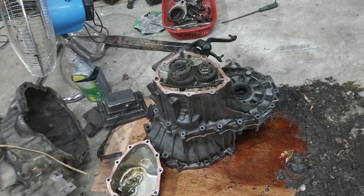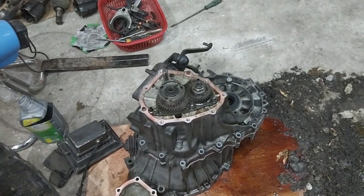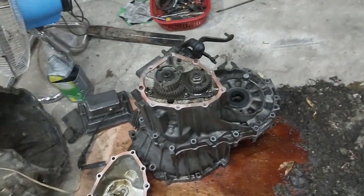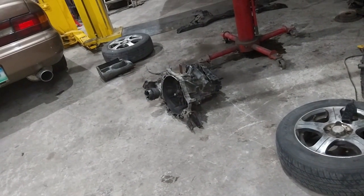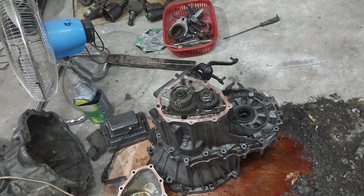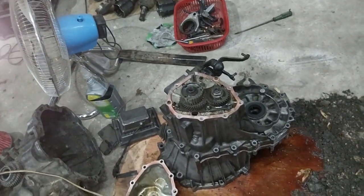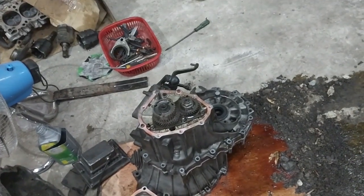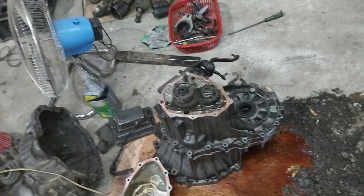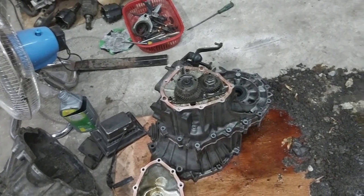In the process of disassembly, I also acquired what is supposedly a C56 transmission. We'll confirm by counting the final drive — if it's a C56, it should have a shorter final drive of around 4.2 to 4.4, compared to the C52's 3.7. This one has an open diff, but I've acquired a clutch-type limited slip differential to put in it, assuming it really is a C56. However, it's known to have a grinding third gear, which is why I got it at an affordable price.